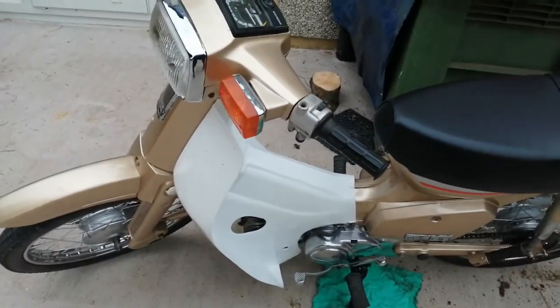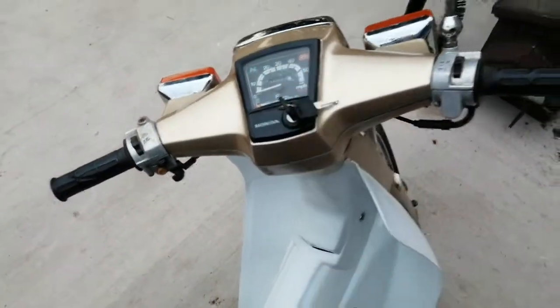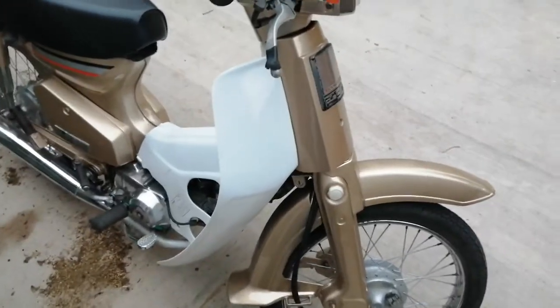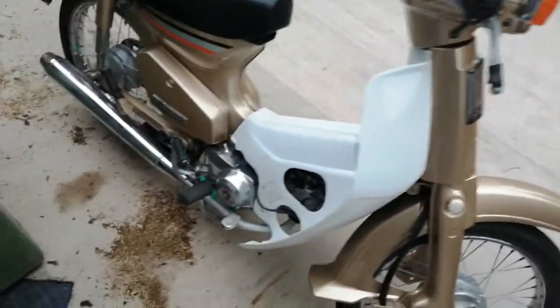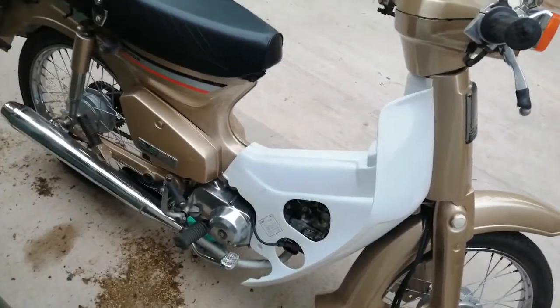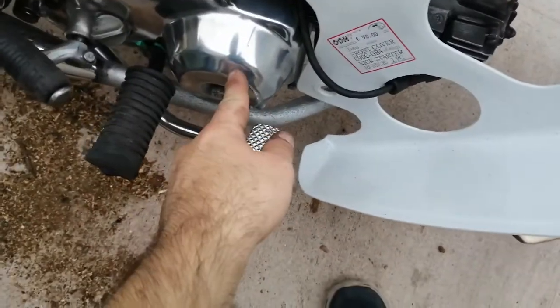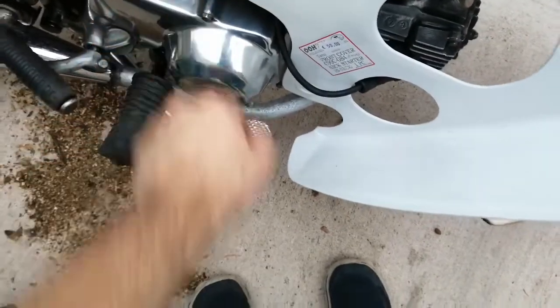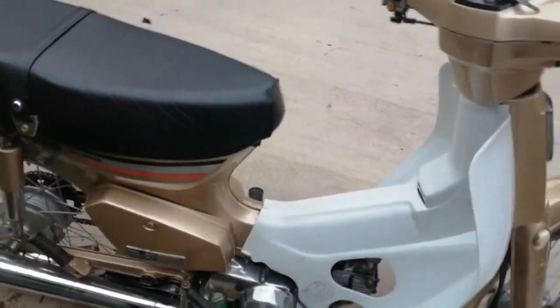As for the reason why it's stopping, I don't know. Sometimes I'll hit the kickstart and it won't turn over at all for a few kicks — you'll hear this kind of whining. It's running now, so I don't know what the issue is there. The clutch is pretty far gone too, it's starting to slip. I did try and adjust it but it's at the full extent of what it can go to, so that's going to be an issue as well in the future, but it's okay for now.